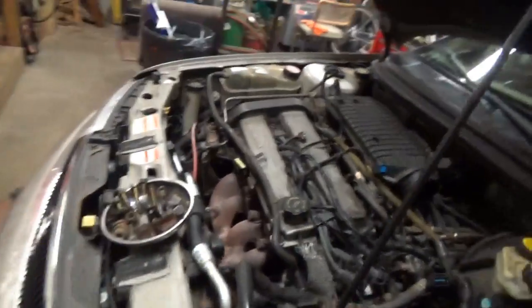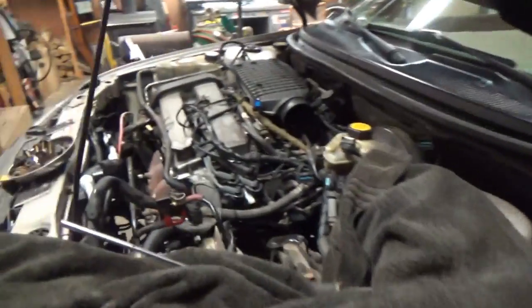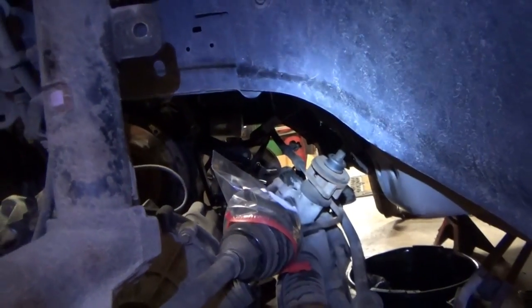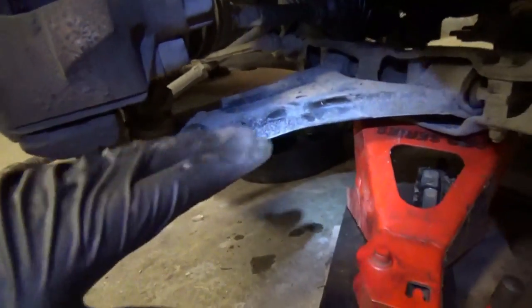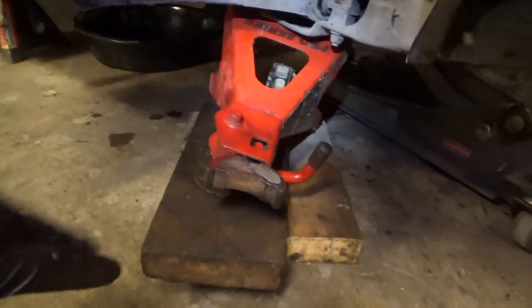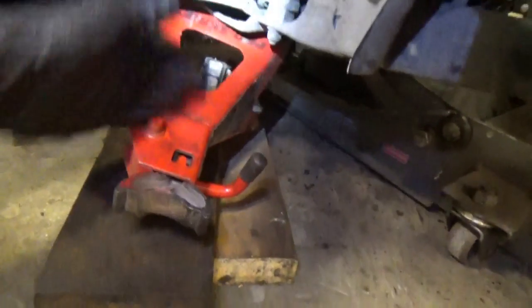In this car it is not as easy as a Subaru — this calls for about a 10-hour labor time. You have to drop the subframe; you can't take it out the top, there's no room. You kind of tilt the engine down. I didn't disconnect the power steering lines, and I didn't disconnect the right control arm on the ball joint — it actually helps it hang in its happy place. So there's almost no weight on this jack stand right now.